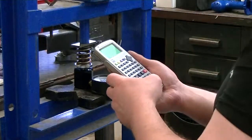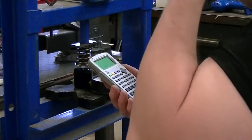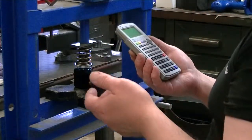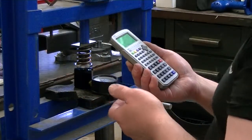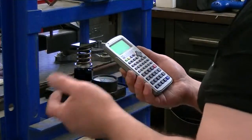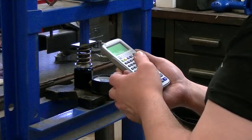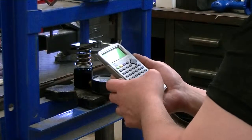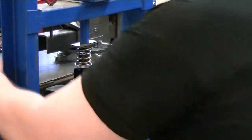So I take the 1 inch 900, and I subtract the max lift of my cam, which actually I have 621 on the intake, 627 on the exhaust. So I take basically the center of that, well, more or less the center. I just take 625 since that's a quick, easy reading. Okay, so minus 625 lift. Okay, that comes up with 1 inch 275.